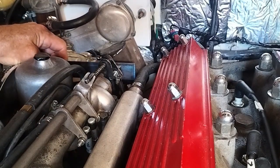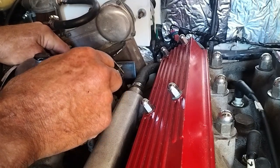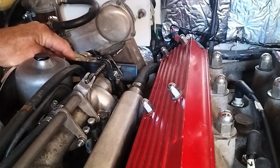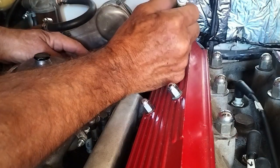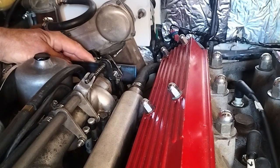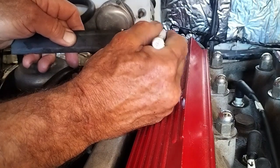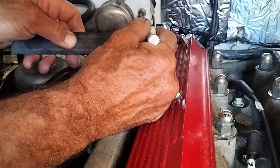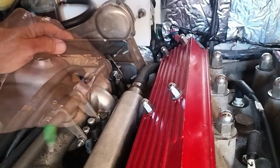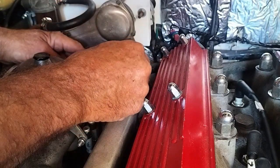I've got some 32 by 3mm steel. The limiting factor is going to be avoiding this heater hose when the throttle goes up, so it's going to be a bit of a fiddly job. I'll put a bit of a radius here and probably another one there to make it look nice. Hopefully when the throttle opens it'll clear the heater hose.